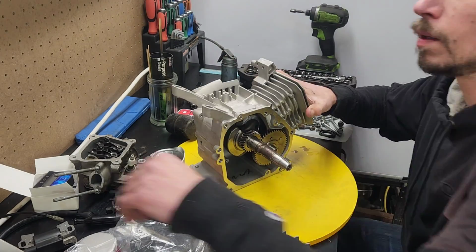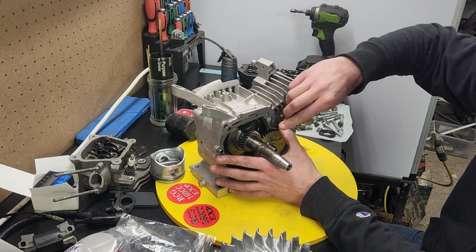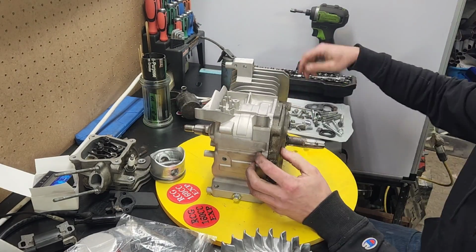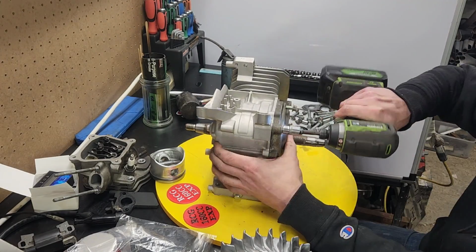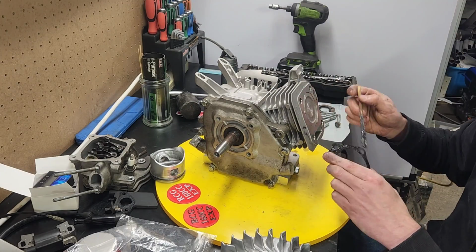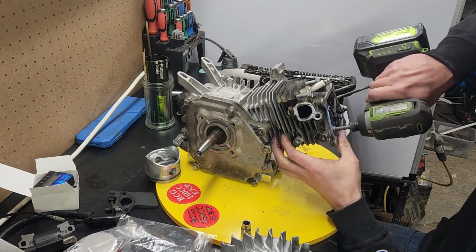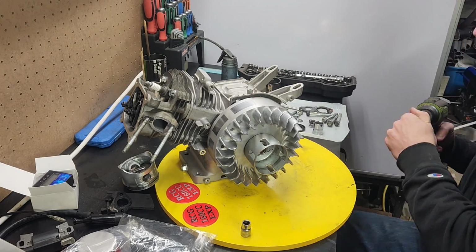Line the dots up on the cam, stick the side cover on, realize I have the wrong dowel pins, go get different dowel pins, put the Chinesium side cover on, have it not quite line up, slam some bolts in, come to the conclusion I'm missing one bolt from the previous owner. Now we're going to grease the snot out of this head gasket because I plan to take the head back off because I'm going to swap to a different block. Remember, advanced is always better than retarded. Hold your flywheel to the right while torquing it down.